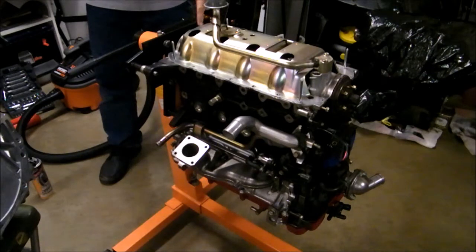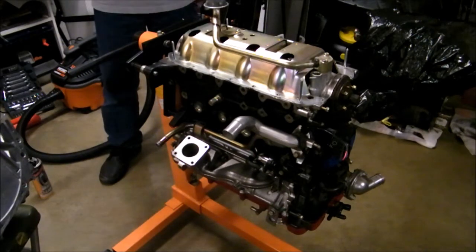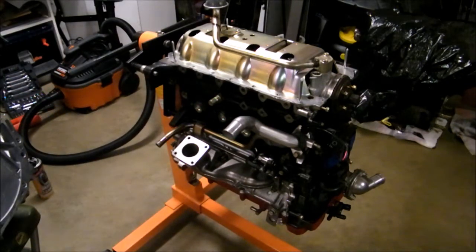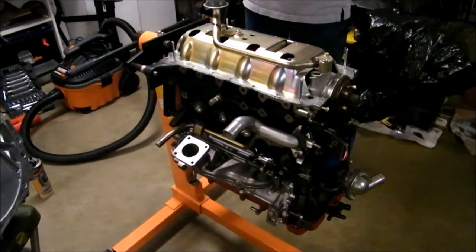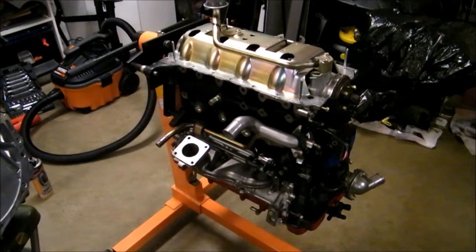Yeah, the seal on the back of the engine, it's 7.5 foot-pounds of torque, or 95 inch-pounds or something like that. It comes up to 7.95 foot-pounds on the seal on the back of the engine. And these are all the same size bolts, so I'm just torquing it to those specs. Now the next thing that I got to do is put on the oil pan.